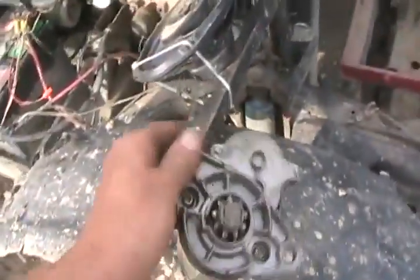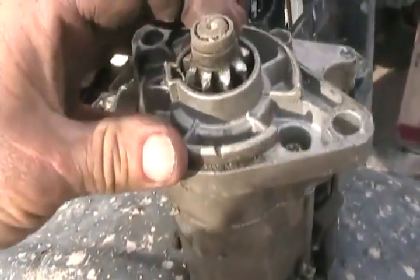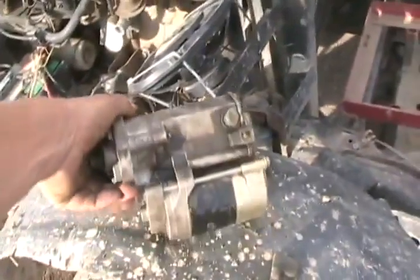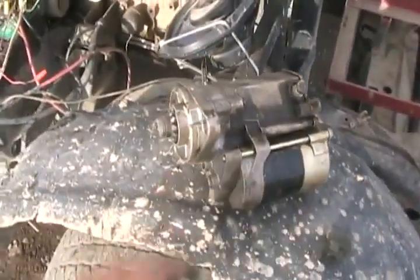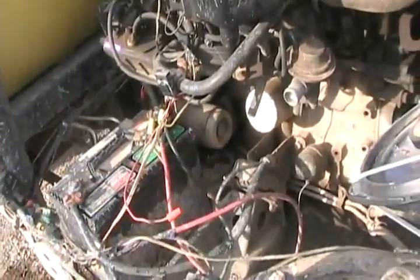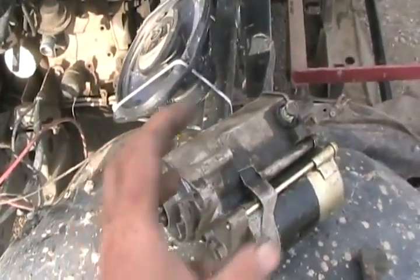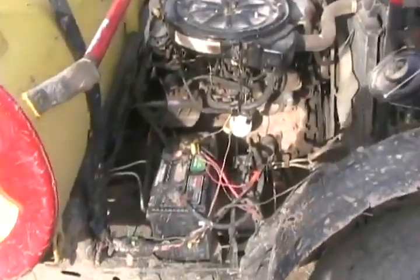The worst thing that's gone wrong with it is the starter motor. Most of the time when you turn the key it would just screech and not engage. As you can see, the edges of the Bendix are all chewed off. This is actually the starter motor from my Cressida — the previous owner had a couple parts cars and gave me two spare starter motors, including a rebuilt one. I took the Bendix out of that rebuilt starter, put the Cressida one back in sealed up for future parts, and installed the good Bendix. Now when you crank the key she engages a hundred percent every time — no more grinding.